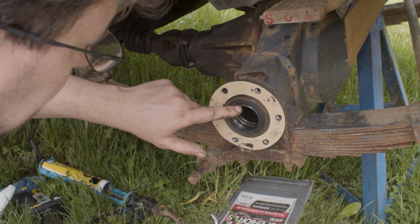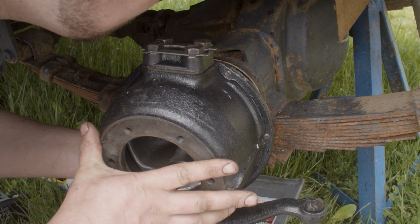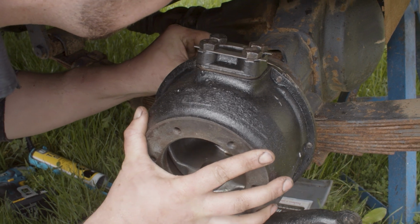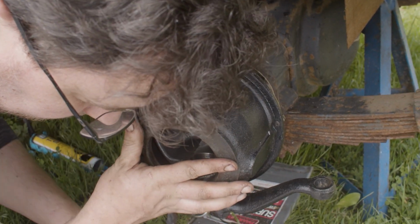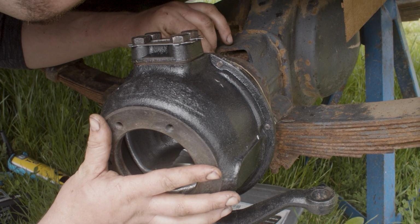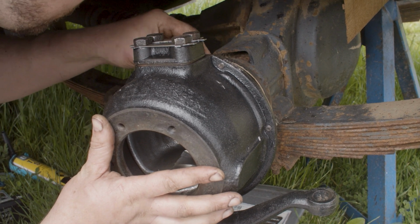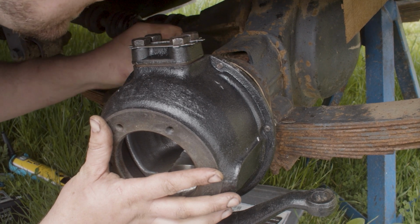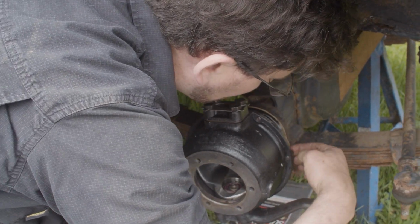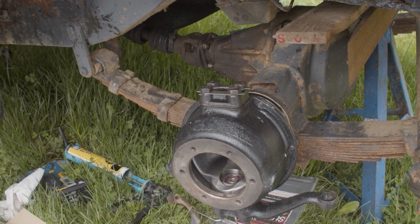Okay, so we have this gasket in place, we have that tapped in flat. So this guy now has to sit in there, and we want to get a couple of bolts in to hold them in place. So you get one in anyway, and holding. Now one side of this needs the steering limiting bracket, and it's held on one of these bolts. This comes over and hits the steering limiter, so we'll have to find that in our bunch of stuff.